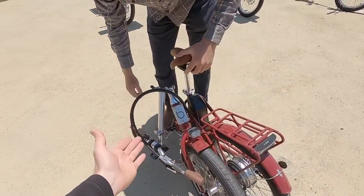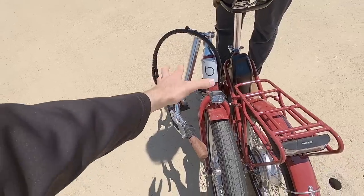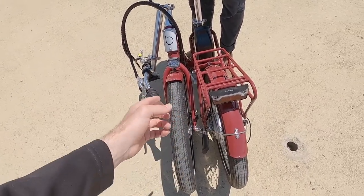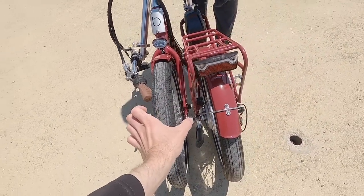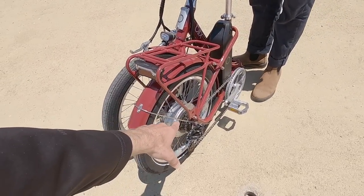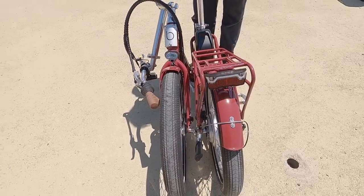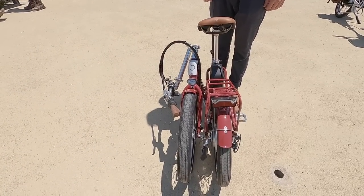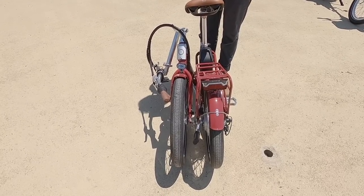And then he's doing the final piece here, which is the handlebar. If you have a bungee cord or a strap, there's a little bit of movement there. But the magnets, in addition to updating the design, they removed quick release from the front wheel, so we have 15 millimeter nut, still 100 millimeter, it's a 9 millimeter axle, 100 millimeter hub spacing. Over here, 135 millimeter hub spacing with, I think, 18 millimeter nuts, but having that be a little bit sturdier is great, because you don't want this thing rolling all around. It just feels cleaner, and I haven't seen too many companies modify that magnet interface.